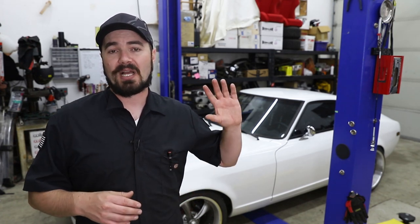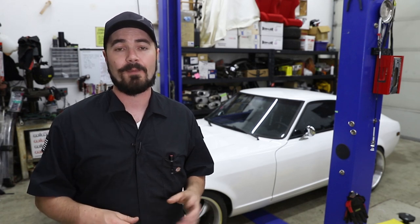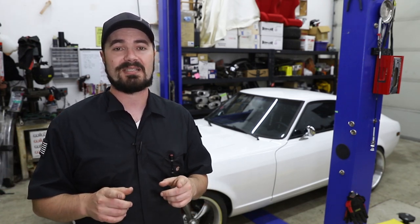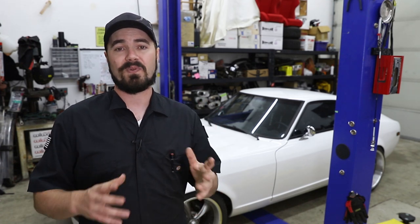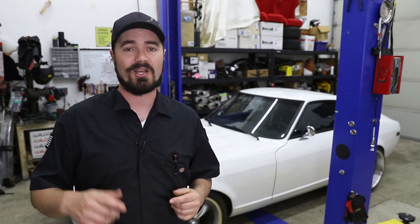The new fuel pump in the car seems to have fixed the issues I was hoping it would fix, and it made the car a lot quieter when it's priming. I also got that little fuel sender leak fixed — that was pretty simple: just cut a piece of gasket material to put under the ring, crimped it all back down, pounded everything back into place, and tightened it all the way up. I also went ahead and fixed the issue with the differential, and that's exactly why if you install a big part on a car you should always check on it a few miles after installation. That fill plug hissing was a super good indicator of a problem before it became a big problem. I drained everything, fixed the issue, cleared the breather, and filled it with all new Redline fluid. The next time you see this car, hopefully it'll be because I finished breaking in the engine and we're back down on the dyno for drivability tuning. Thank you all for watching — if you have any questions, please leave them in the comments below, and as always, I'll see you in the next video.